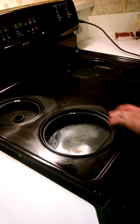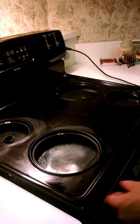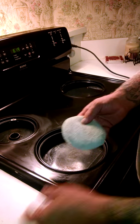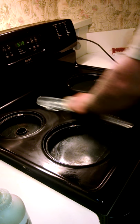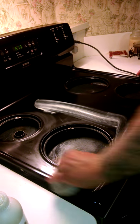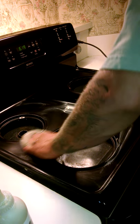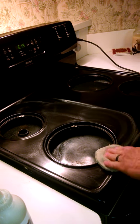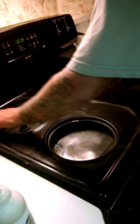Now I'm going to hand the phone over to Rory while he explains how to polish out the stove. You've got some build-up around the burners, some scratches in the middle that look pretty gloomy. What we're going to do is take some cutting compound and put it evenly over half the stove at a time, because it dries pretty quick and you don't want to polish while it's dry — it's not really doing a lot of work. You want to polish it while it's moist and able to cut.